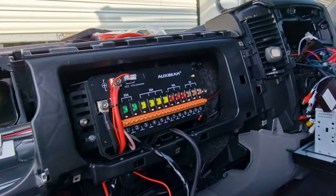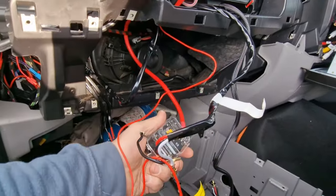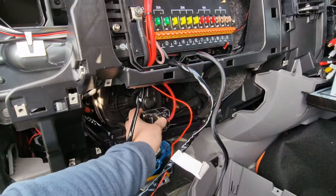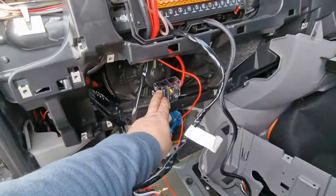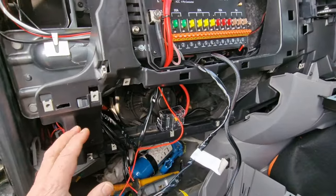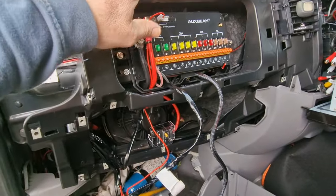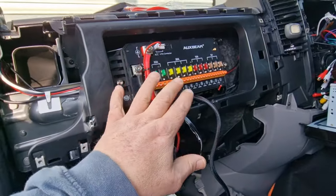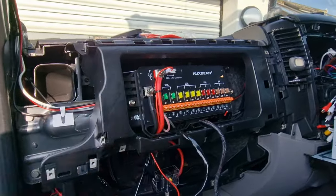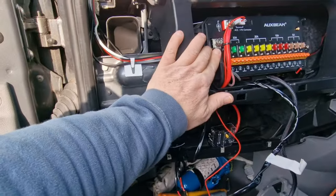While we disconnected all the old relays and feeds, I took out the old fuse board. I'm going to mount the new switch in its place. This is a breaker - we can just reset if anything goes wrong, but that requires a 16mm feed. This is the auxiliary feed that gives you an ignition signal, so any ignition-powered circuits, any circuits you want to come on when you've got the ignition on, will come on. That's a flat wire, and basically we're down to the ground there with the earth.